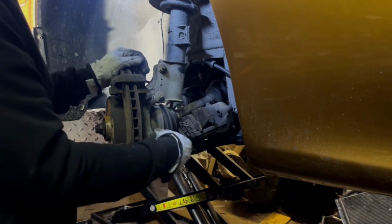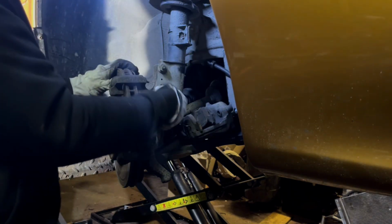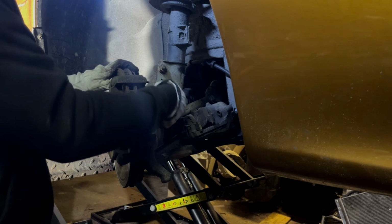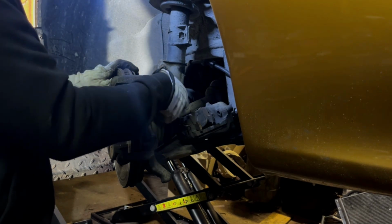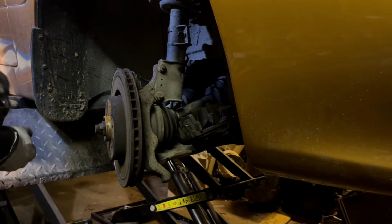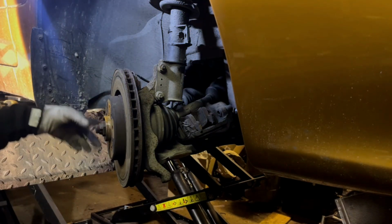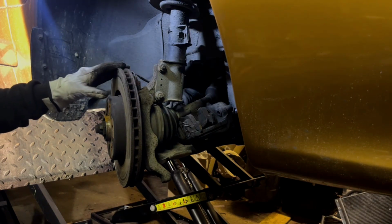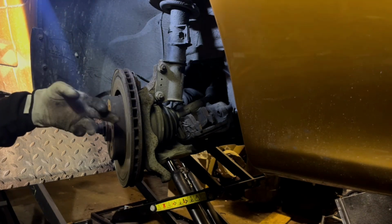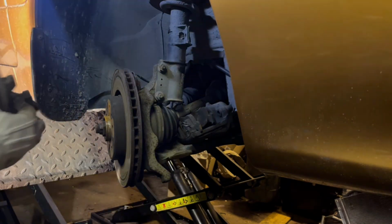On these Volvos there are several types of front brakes. Generally on the Volvos, it could be so-called 15 inch, 16 inch or 17 inch brakes, and 15 and a half, and it's a bit of a struggle to find or remember it. But of course the best way is just to measure your old brakes. For example, these are 302 millimeter rotors. There is one more, 322 if I remember right, and there are smaller ones as well. So just so you order the right one, measure before.